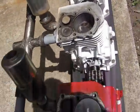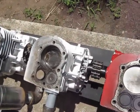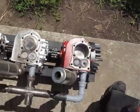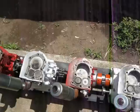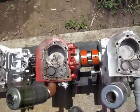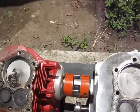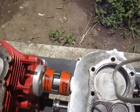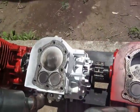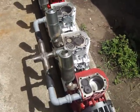I'll spin it over here and try to film this so you can see the various piston movements - one's going down, two's coming up, three's going down then coming up. On an inline six like this, pistons one and six are phased together, then two and five, and three and four. As I spin it over, three and four will move together. Then I got two at the top and five at the top.